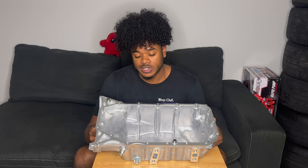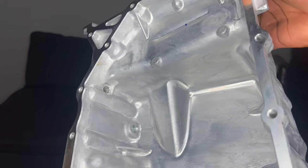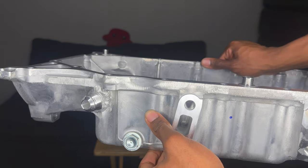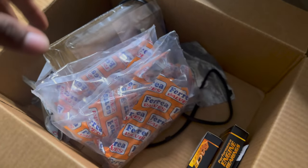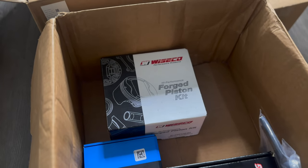The last oil pan we had on the engine got a hole in it, so we got a new one. You can see right here we have a 10 AN bung welded onto the oil pan for the turbo oil return drain — I figured this was a good spot, the highest point above the oil level we could go. The filter comes down right here so we cleared it. All new gaskets and seals — new rear main seal, new seals for the VTEC solenoid, the whole cylinder head gasket kit. We're doing Manley Turbo Tuff I-beam rods, 80-pound Supertech springs and retainer kit, and we're sponsored by Wiseco so we're doing Wiseco 11.1-to-1 compression ratio forged pistons.